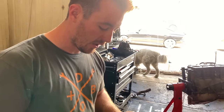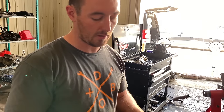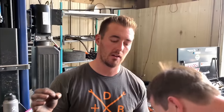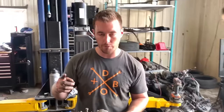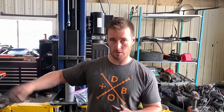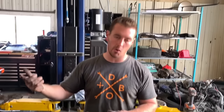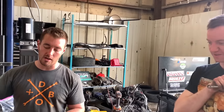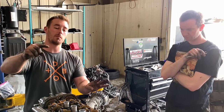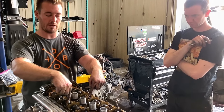It's very basic. But unfortunately on this motor, it is an absolute pain to rebuild, and it is an even bigger pain to get the timing perfect. So if you're working on an S54 and you're timing it, once you get everything right and you're 100% sure it's right, turn it over 3 or 4 times, and check the timing again. You're going to have to reset it again. That's guaranteed. Reset it again, lock it down, do it again until you can rotate it back to top dead center with the locking pin in and get both of your pins in the cam.